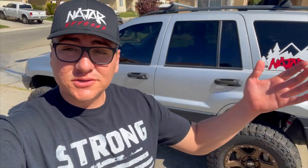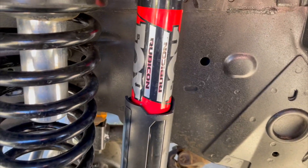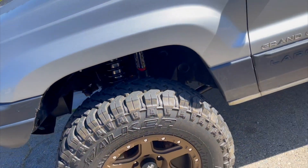It's been a couple days since I did all the work to the Jeep. It's been running good with the semi-synthetic oil, so that's great. I cut the front end and later that day I took it off-roading — it didn't rub, it actually was good, and that's with the sway bars disconnected as well. I was surprised — I was expecting it to rub. One thing I did notice is that since the shock has the extension on the bottom and top, I will have to add a one-inch spacer because the shock was bottoming out when I was off-roading. Other than that it's not rubbing, so we are good to go.